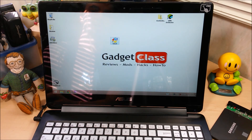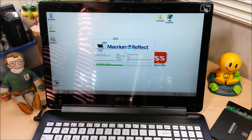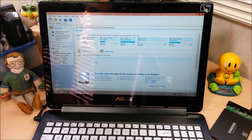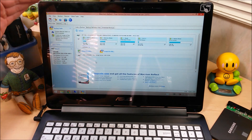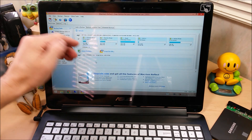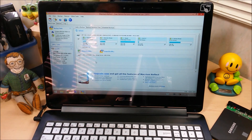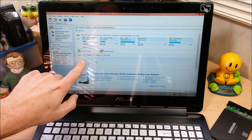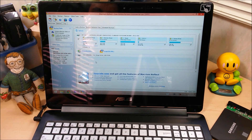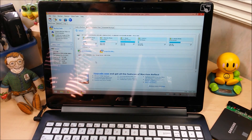Go ahead and double click that, click yes. It scans the bus — it wants us to register, but select do not remind me to register. This is your main Macrium screen. You've got our primary hard disk here — this is our 1TB Samsung 5400RPM drive with 5 partitions on there. Down here is our secondary drive, this is our new SSD — disk 2, mass storage device, 465.76GB. You can see there are no partitions on it; it's a clean new hard drive.